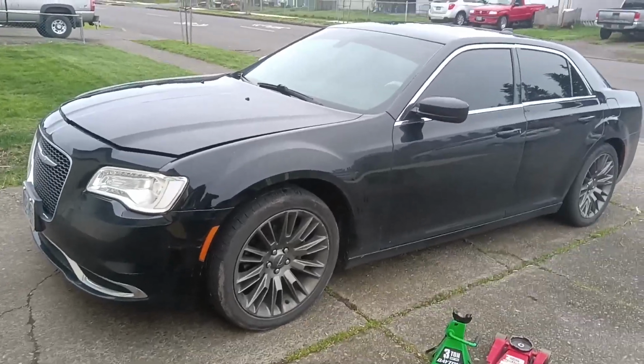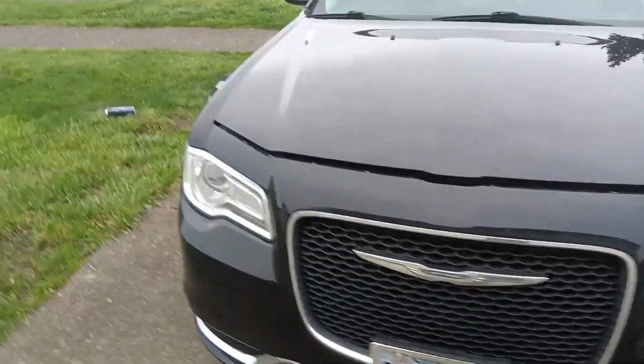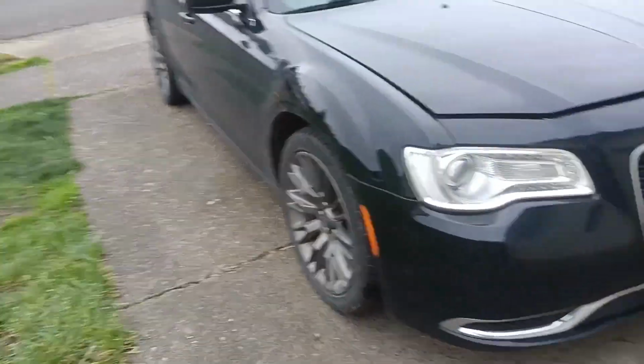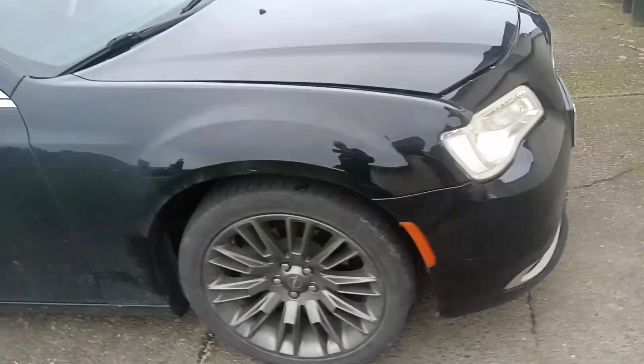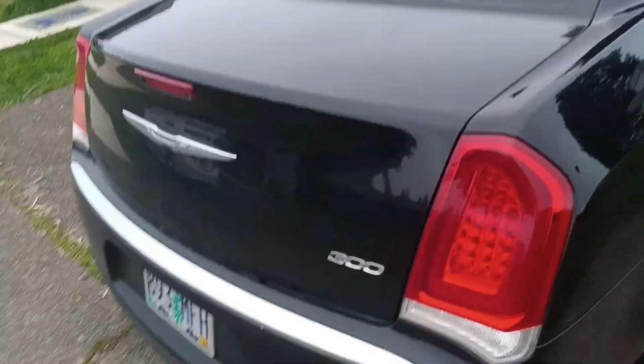Well, folks, just got done with the test drive and the beginnings of the break-in procedure, although I'm going to let the customer take care of the rest of the 30 from 30. We're going to go over that real quick in a moment. With this burnishing compound, it goes very quickly anyway, and we have old rotors. We're going to have new ones, so I don't want to overdo that and overheat those guys.